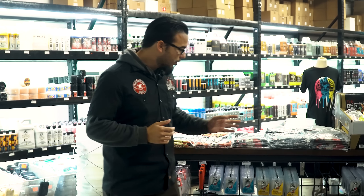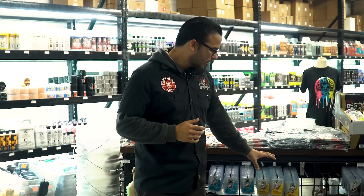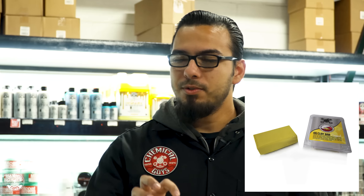For something a little bit older, or maybe a car that hasn't been detailed that often — maybe every six months to a year — you can use something like the OG clay bar, which has a little bit more of a stickier consistency. A clay bar is basically a sticky patty substance which pulls out any kind of impurities and contamination in the pores of the paint to give you a really slick finish.